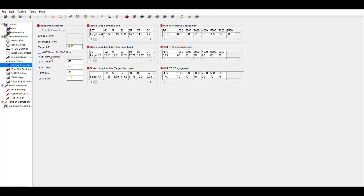The wide open throttle map is only useful if we're going to use this tune for drag racing. We'd load this tune up for drag racing, and then the system won't go off throttle position — it'll go into wide open throttle mode based only on the MAP, that millibar pressure we discussed earlier. We're not going to mess with that — we're going to turn that off. We do want it to be wide open throttle based on the throttle position.